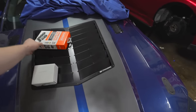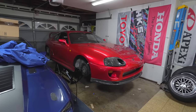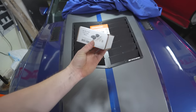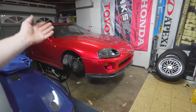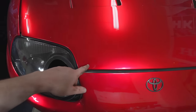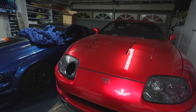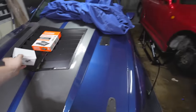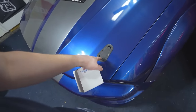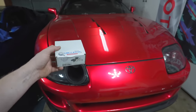I'm also going to inspect axles and everything, but I'm really happy I don't have to order brake pads. Now you might be wondering why we're cutting holes in the Supra — I am serious about that. We are cutting some holes, but it's not what you think. Although a bunch of holes on this thing may or may not help aerodynamics — science has yet to prove that — we are actually installing some hood pins. I'd recommend this especially if you're going to do some high-speed runs. Any aftermarket hood is not the most trustworthy. My Seibon one has been pretty solid, but there are some slight pressure cracks, and that may or may not cause a hood flutter at speed, so just to be safe we're going to install some quick-latch hood pins.